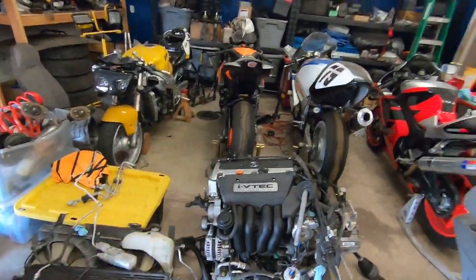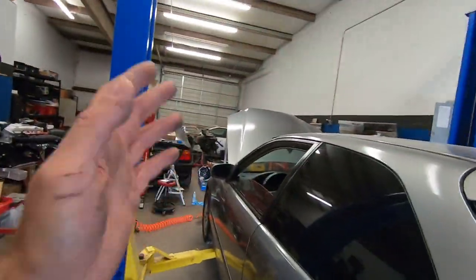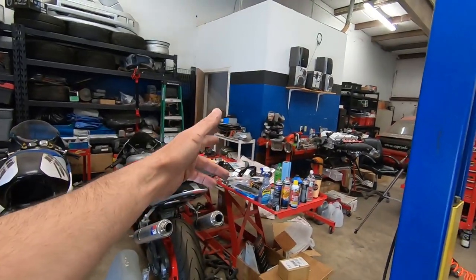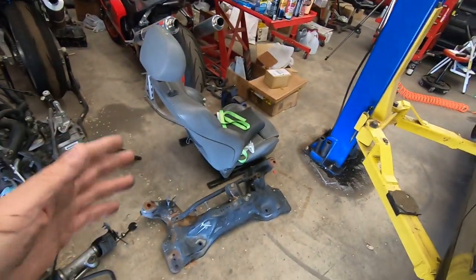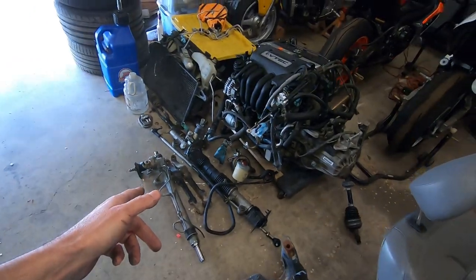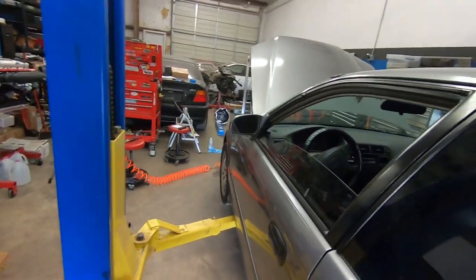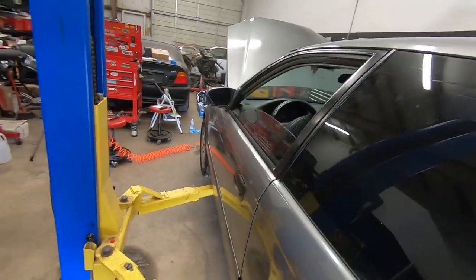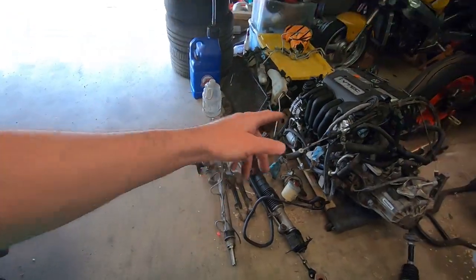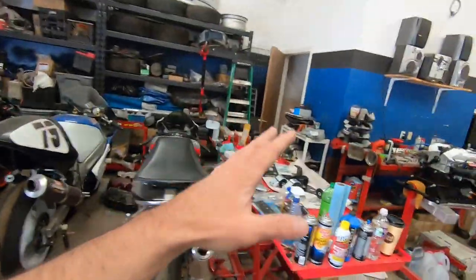I was doing research on this chassis, and on the EK and EJ they say the crossmember sits the engine a little too far forward. Hasport has an answer for that with their EKK2 mounts, but you have to utilize a 92 to 95 Civic crossmember or a DC2 Integra crossmember. I sourced out a DC2 Integra crossmember and a power steering rack, because this car currently has a manual steering rack. I really can't stand it — the steering ratio isn't great and I want a more precise feel. The power steering Integra rack and pinion is going to give me that, and I do have the power steering pump, so I'll be converting this car to a power steering setup.